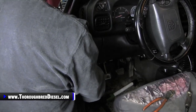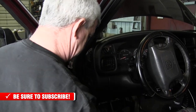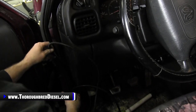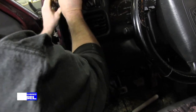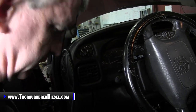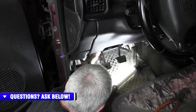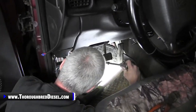I'm going to pull this out while I'm here because I want to run my light drop for the actual light and show you how we do this. I'm going to run it up this side and I'll show you where I'm going to mount it. I want to put my light right here because the owner of this truck doesn't want us to drill any holes in his dash — I understand that too. So we're going to put the light right there. Now we've got our power, so we've got to go ahead and get our ground. You can get a ground just about anywhere — just make sure it's a good ground. I was using my test light on these bolts for the steering column, so I'm going to take one of those bolts out and that's where I'm going to catch my ground.